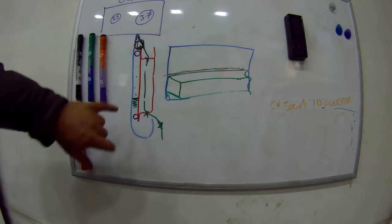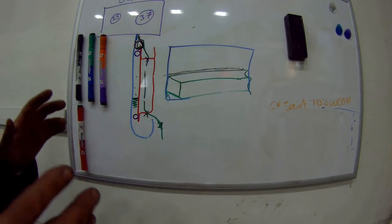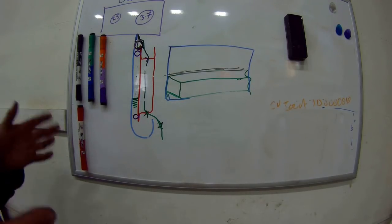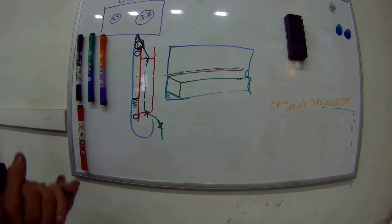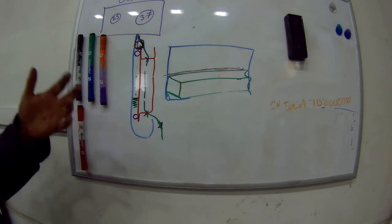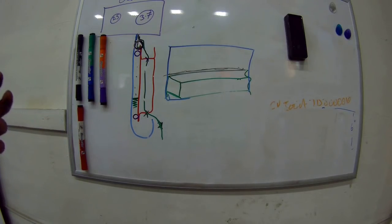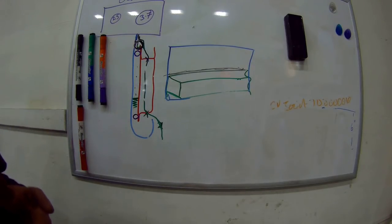This is principally if you've got the aluminium door skins and the steel frame. If it's just a galvanised one like I showed you earlier, then you haven't really got a problem. You can still rust proof it, but hey, why bother? So there's a few little tips for Daniel, so you can understand now what I was saying about putting a new door on. Because honestly, if you've got an aluminium door skin that you're going to put on, it's tricky to do. It's not impossible, but it's difficult to repair.